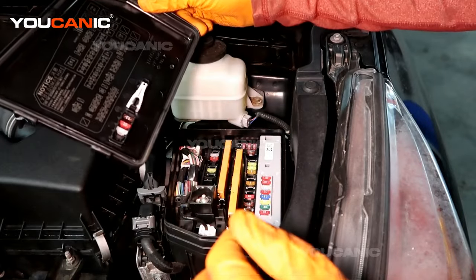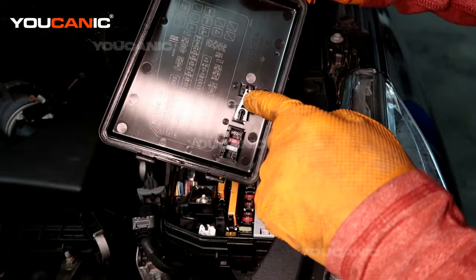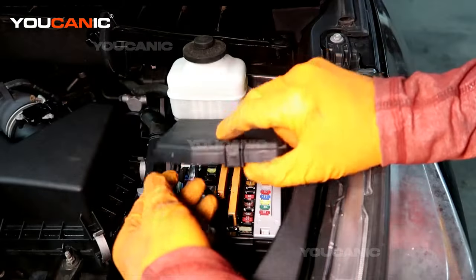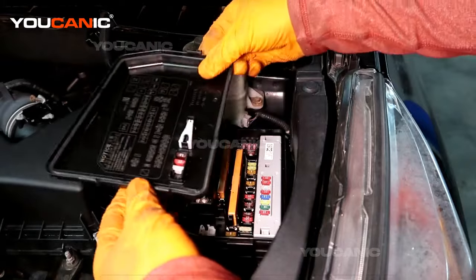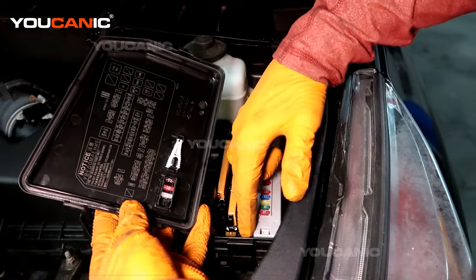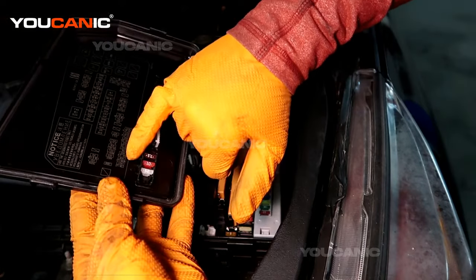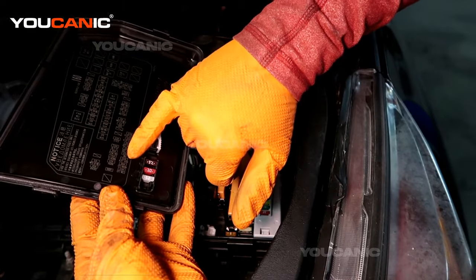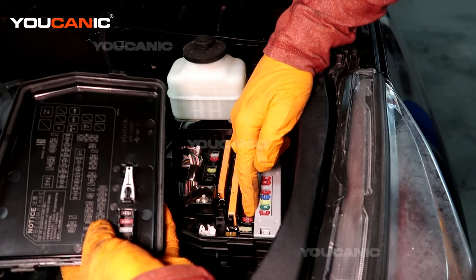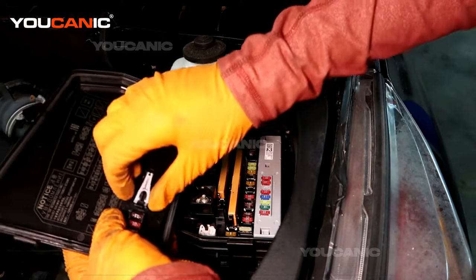As you flip it over, we have some spare fuses in the top and a fuse puller, and then we have these fuses here. Pull up the lid like this, and if you hold it upside down you can read through here and match these fuses exactly the way they need to. They'll tell you what they do — like this one here, number 10, that operates the horn. So if your horn is not working, that's one thing you could go ahead and check.